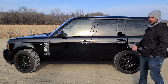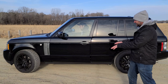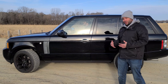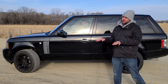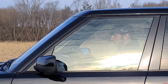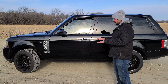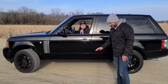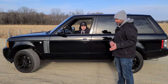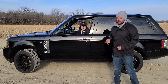Another cool feature of the Range Rover is that air suspension. It really makes a difference and proves some amazing capability. Right now, as you guys are looking at it, this is the access height — as low as it can go. You can't drive it this way; there's only one setting you can drive it at, and you can drive it lifted only up to about 40 miles an hour. The only other time you'll see it lower is at speeds in excess of about 115 miles an hour, where it lowers a half inch from normal height. With the factory air suspension, it can go up about two inches and down about two inches.